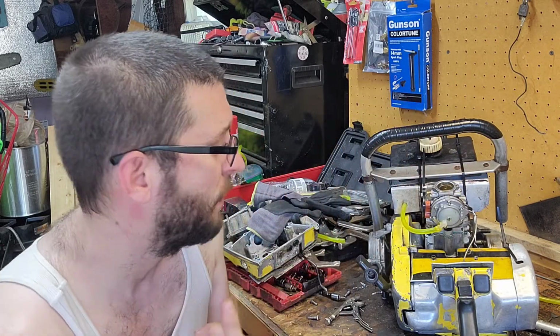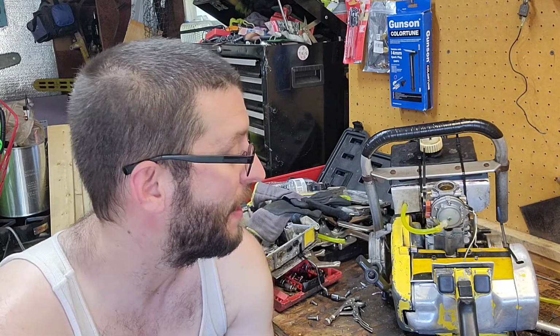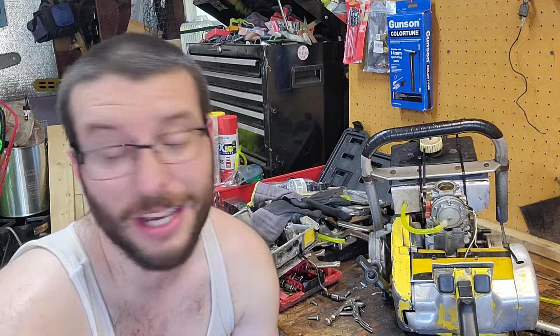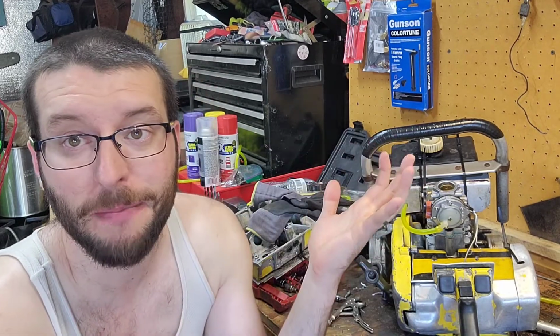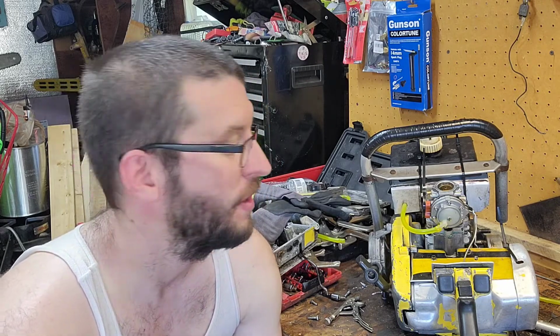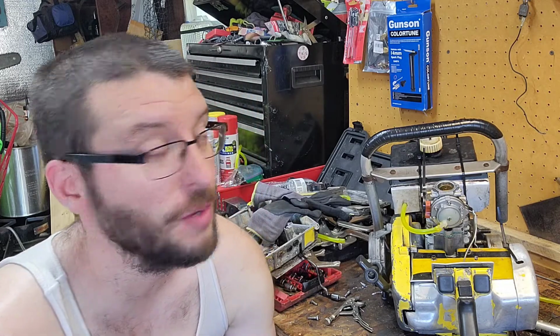Crank seal, everything. Now, the exhaust is missing one bolt, I doubt that's the issue. I've had this thing running good without that, but the second you spray where it's not bolted, it falls on its face. Of course, typical 2-stroke, it's probably sucking some back in. It just falls on its face immediately if you hit the exhaust with it. I've been told it will not affect it.